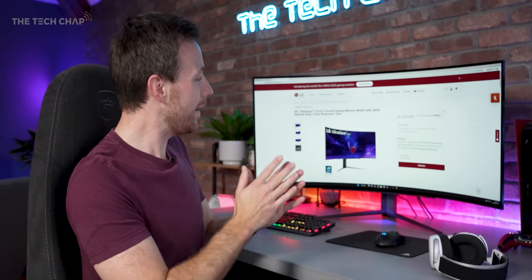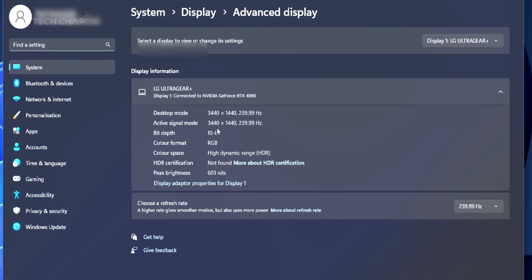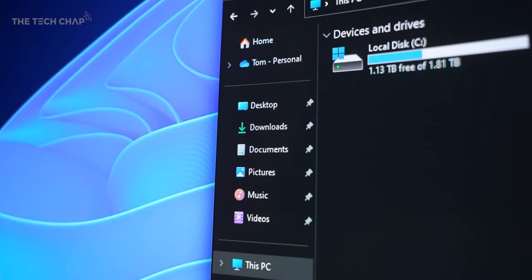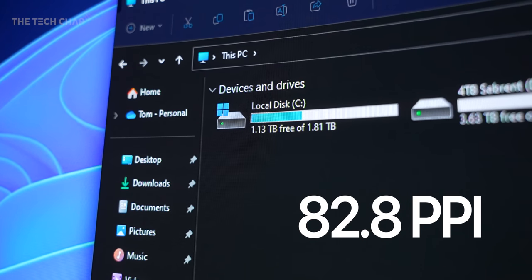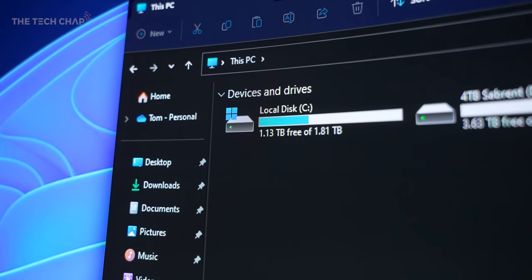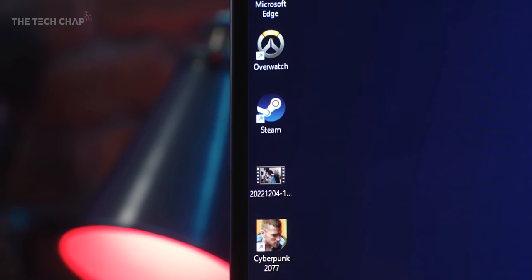What is more of a deal-breaker — and you really have to be sitting in person in front of the monitor — is the resolution. This thing is 3440 by 1440, which at 45 inches gives us a pixel per inch density of just 82. That's the same PPI as roughly a 1080p 27-inch monitor. And actually it's a whole lot worse, or at least more obvious on here because of the sheer size — like going with a 2560 by 1080 on a 34-inch ultra-wide. The resolution is just too low. You can just about see individual pixels, particularly on the desktop or when there's text.